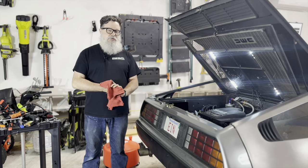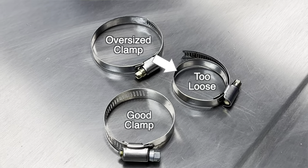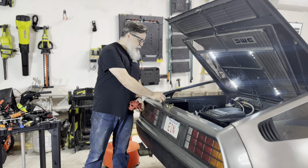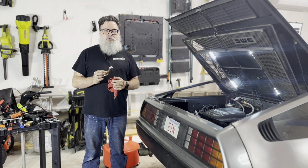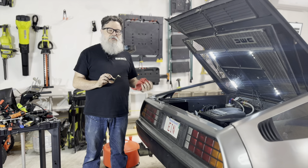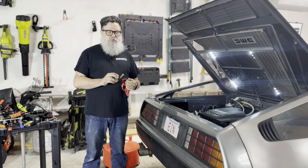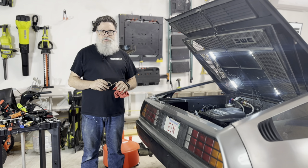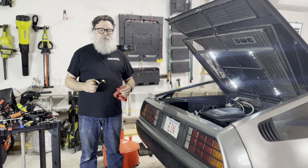The installation went pretty well except for a few small hiccups. The hose clamps that came with it were too large, so I replaced them with properly sized, more robust ones. The other problem was the mounting bracket — it's supposed to attach to the AC compressor, but that mounting location doesn't exist on a 3-liter engine. In the stock 2.8-liter there's a clear location, but not in my car. I've concluded this bracket is superfluous for a 3-liter engine; all the belts and hoses clear everything.